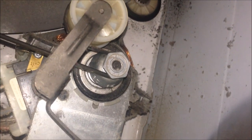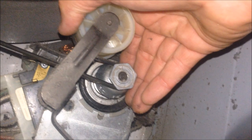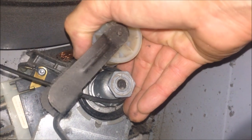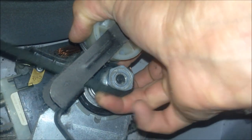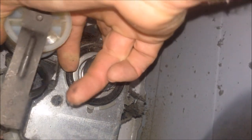Our next step is to remove the belt from the motor. To do that, you want to pull up on this idler pulley — that's going to relieve the tension on the belt — and just slide the belt off of the motor pulley right there. That'll release it. So now the drum itself is free to fall off and the belt is loose from everything. Without going much further, I can see my noisy little problem is that wheel back there. Let's take a close look at it.